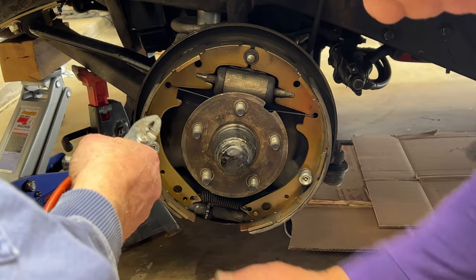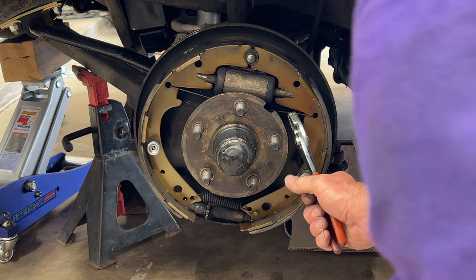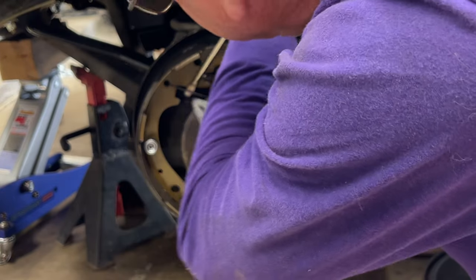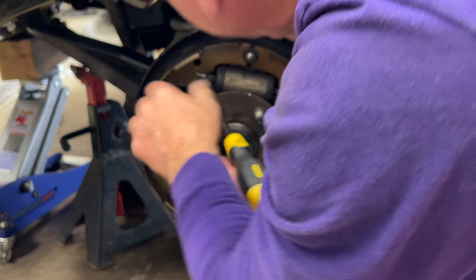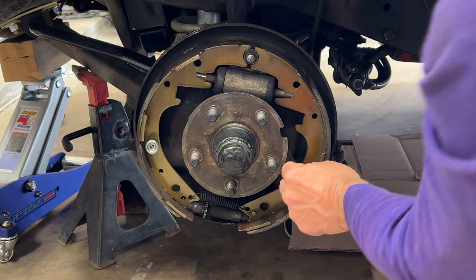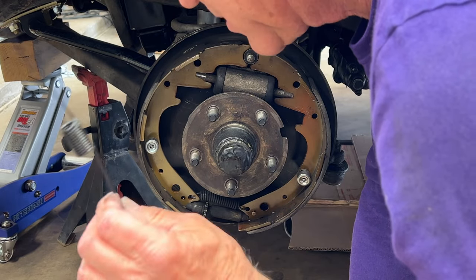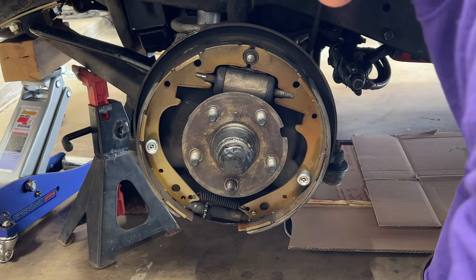You want to pull the middle spring next? Yeah, we'll take this middle spring out. If you've got a '57, you probably have this middle spring. Sometimes you do, sometimes you don't, because they don't always get replaced. We'll take that spring out. And some people do attempt to put them back in when they put the new automatic adjusters on. I'm not going to. It's not clear really why Ford even put the spring in. They didn't have them pre-'57.